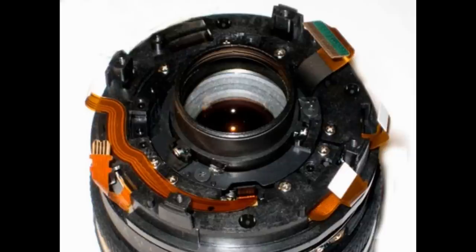Take six screws off of the outer plastic ring that holds it on. Look at the different shaped tabs as they go in and out, and remove those six screws, then remove that outer plastic ring. With the outer black plastic ring removed, you can remove the six screws that hold the inner circle.